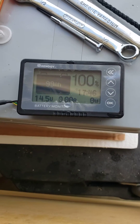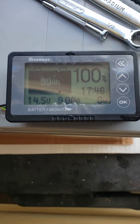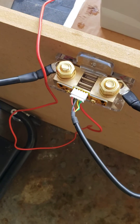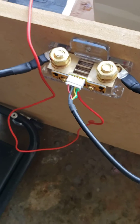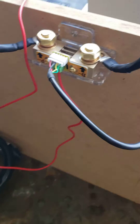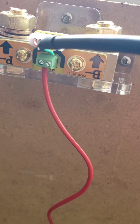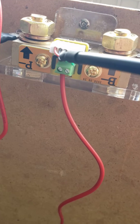It's a pretty easy setup. It comes with the battery monitor itself, a control cable that runs from the battery monitor to the shunt, and that red cable that hooks below the shunt. You'll need a small screwdriver, and it doesn't matter which terminal you hook it to.